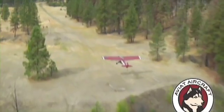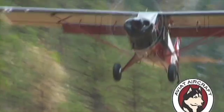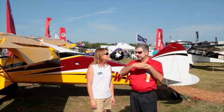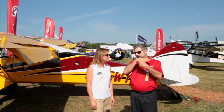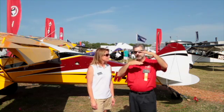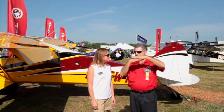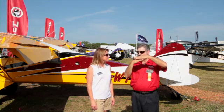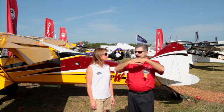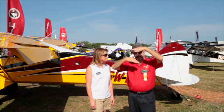So it's just a little shock absorber that sits inside the landing gear — how does it actually work? There's an internal shock absorber inside, attached to the arm of the landing gear. The extension of the gear leg goes into the fuselage, and it's attached to the fuselage bungee truss structure with a rubber band, which we call a bungee. In normal landings, as the weight of the wing is transferred to the wheels, the gear splays out and stretches the rubber band.